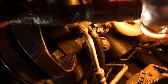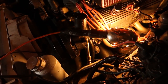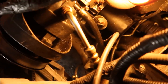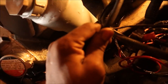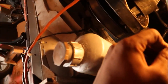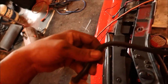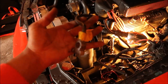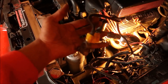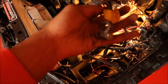I'm not sure how removing that will affect grounding the motor. I know the motor has other ground straps on it. What I'm actually going to do is rather than unbolting the grounding strap from the motor, I'm just going to cut this ground strap. I'm going to ground one end to the chassis, then reuse the other end of this ground strap in the back and ground it to my cage — that will be my negative terminal.